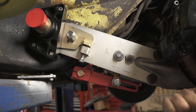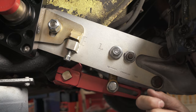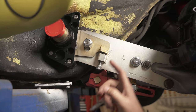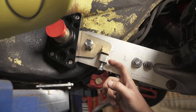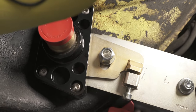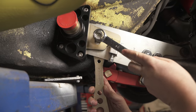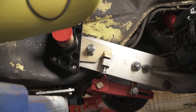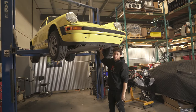I went through and made some final adjustments. I put the wheels on the car, put it on the ground, and dialed in the camber using this bolt — put an Allen wrench on the back when everything's loose and it's really easy to adjust camber in and out. I noticed the ride height was a little too high, so I loosened this bolt to drop it down. These are the easy adjust spring plates we sell — really easy to adjust ride height on the fly. Without them, you have to take everything apart and reclock your torsion bars. Once you're happy, tighten the last spring plate bolt using our T11 Wrenline wrench, which is nice and thin so you can get up behind the spring plate and lock on, then grab a 24mm wrench and tighten everything down. Now we'll torque everything down, put the car on the ground, and make sure we're happy with how everything looks. We got our skid plate on to protect all the new parts on the front of the car.